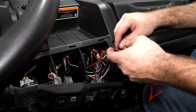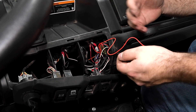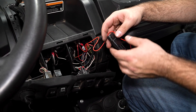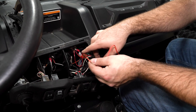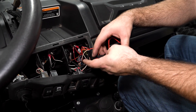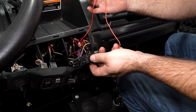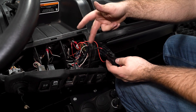Once we've done this, you can cut this harness down, trim it to length, whatever you need to do — that's perfectly fine. If you wanted to, you don't even have to use the adapter. You could cut this wire to length, put an eyelet on it, and connect it to that keyed-on power source. We just make this adapter harness for you if you weren't comfortable with making any kind of connections or cutting a harness down.